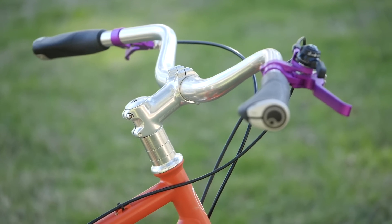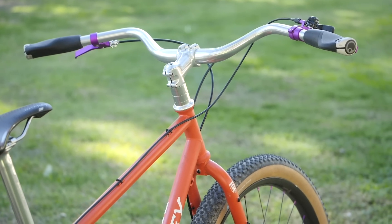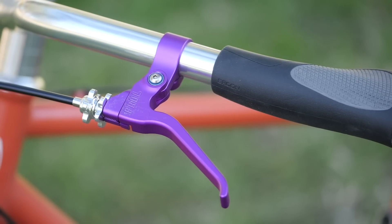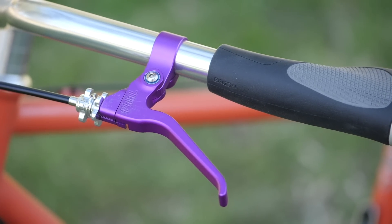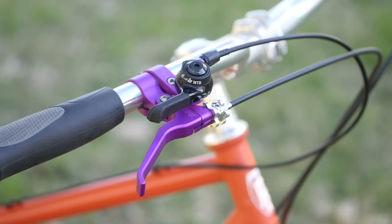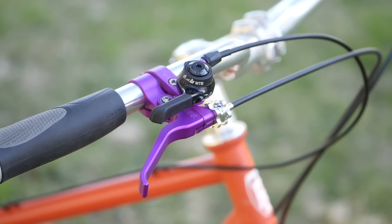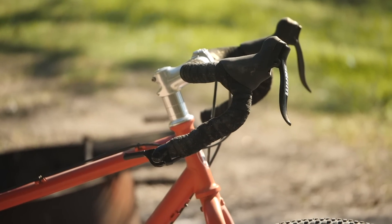Moving up to the controls, I tested it with the Coyote Bars. What's cool about them is they have a forward sweep before they sweep back, meaning if you're converting from drops to the Coyotes, there's a good chance you won't have to change your stem. The brake levers are purple Paul Love Levers, which have a crisp yet somewhat soft feel — kind of boxy and industrial but with a nice rounded matte feel. The shifter is a MicroShift BarCon adapted to the bar with a Paul Thumby adapter. You can shift both indexed or friction — I actually prefer friction. The beauty with this setup is if you swap to a drop bar, you can reuse that BarCon right in the bar end.